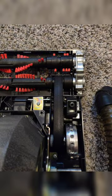So here is a photo showing the transmission and belt system of the Panasonic Dual Sweep. So silver pulley connects to the motor drive shaft. That belt then drives the other belt, which spins one brush roll attached to the gearbox, spinning the brush roll in front of it the opposite direction. Pretty simple, pretty straightforward, kind of innovative, I might say. And the idler sits underneath that belt.